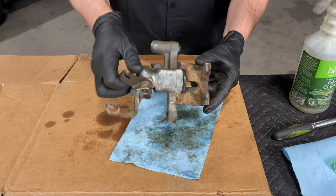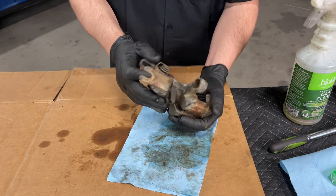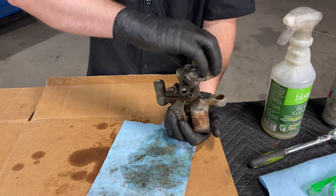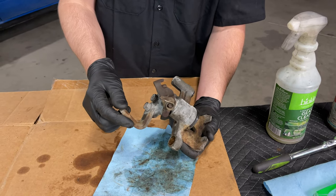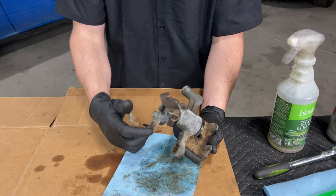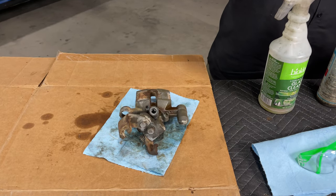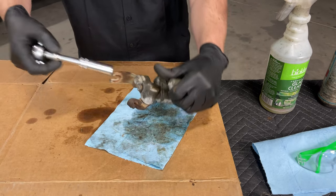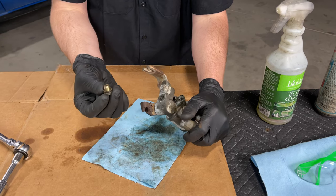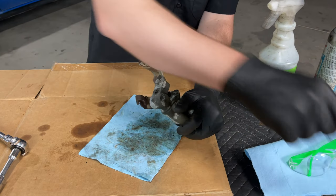Now we're going to turn our attention to the piston. On these types of rear calipers, you would normally apply pressurized air where the brake line came in. But because this is a parking brake rear caliper, you can't do that — there is a threaded rod on the back of the piston that we need to manually actuate out. On the back of the caliper there's a bolt that covers the adjuster. On this caliper it's a 14. I'll just break that loose; it only seals out dirt with a little copper crush washer. Set that to the side — we'll need it.